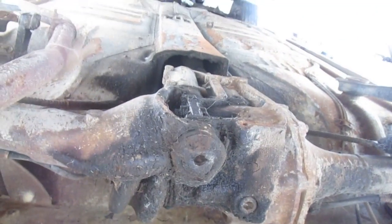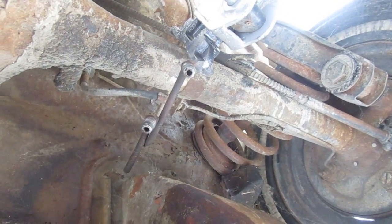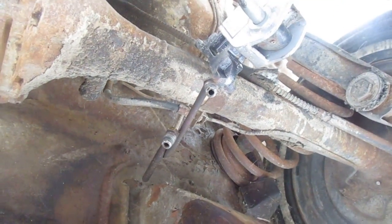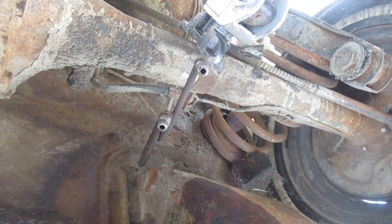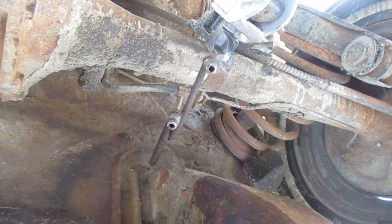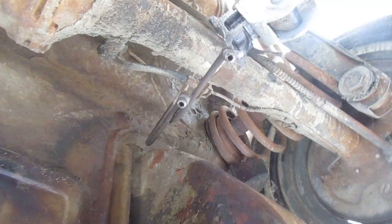That's really all there is to it. If your fuel lines — those rigid lines — are clogged, you can go to a hose shop and they can make you a rigid line, or you could probably run a rubber hose for a good distance, but you want to use rigid steel lines. This one the exhaust isn't bad — it's really got a lot of work though.